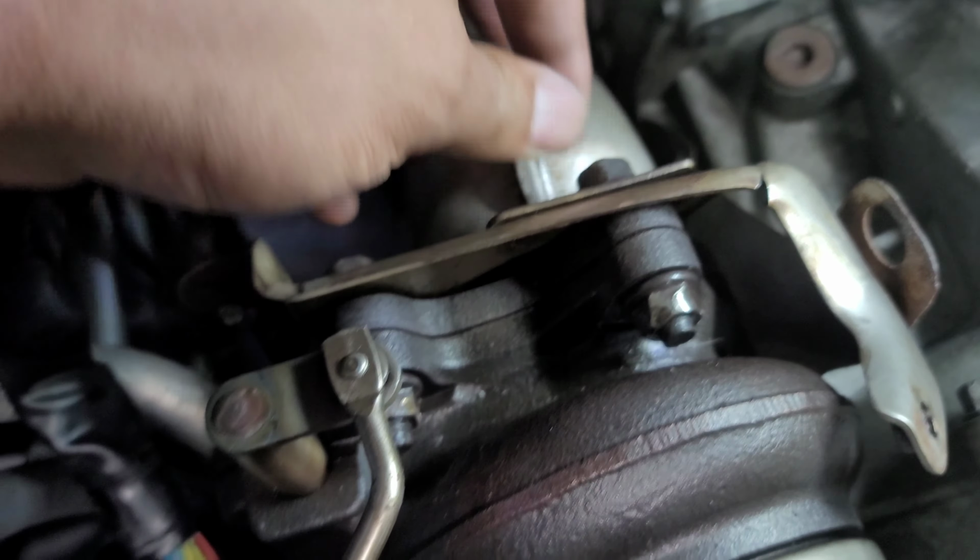All right, guys, I had to go to Wesley's house to use his vise to put that in. As soon as it focuses, let me try to get it focused. There you go. The hole is bored out to 12.5 millimeters, so the O2 sensor will fit into this, and then I have the other adapter right here. So this is gonna thread into it, and it's gonna go into the downpipe. There we are. And then I'm gonna put some anti-seize on this end of the threads, and then put it on here, as well as the O2 sensor. So, sweet. I'm gonna be installing it here soon.